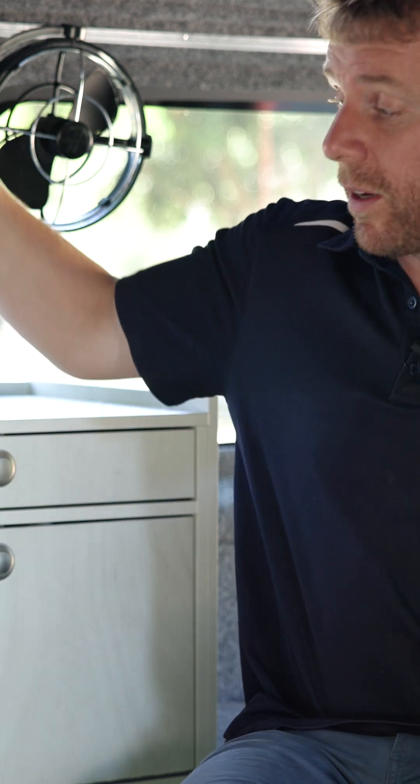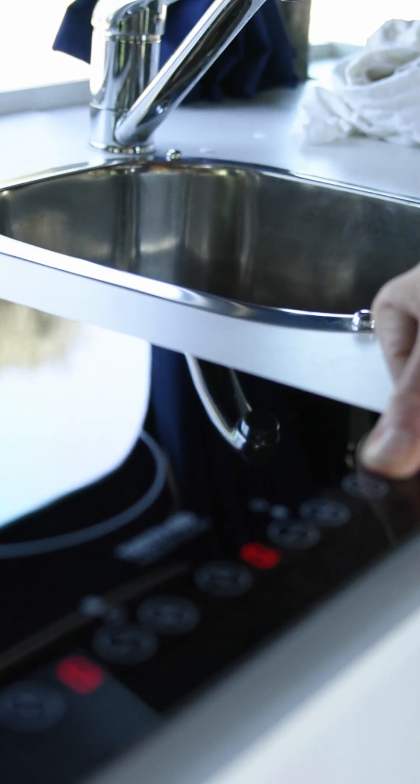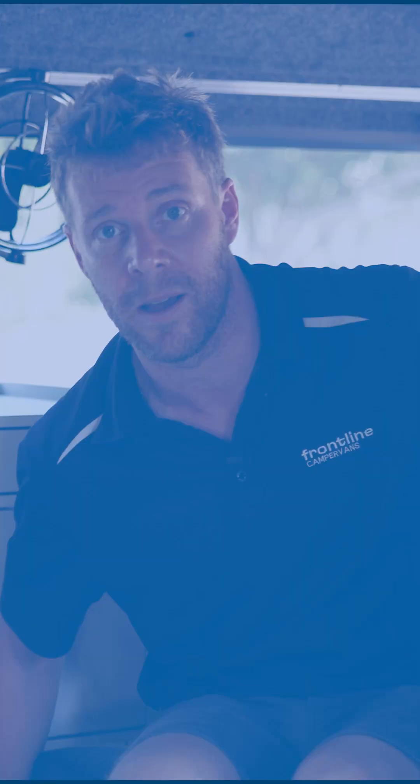With mains power connected, your power points are going to work, you can turn the induction cooktop on and use it inside. But if you don't have mains power, the first thing to check is that your circuit breaker has not been knocked or tripped — it needs to be in the upward position. If it's not in the upward position, you won't have mains power within the vehicle.